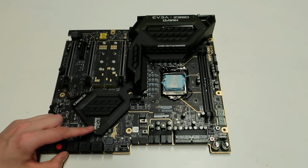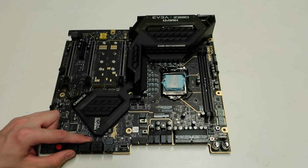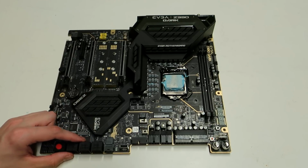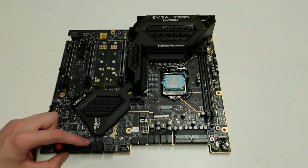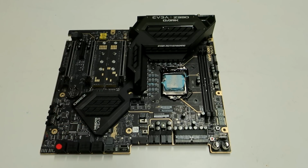For example, the ASRock Z170M OC formula. So with such a board you don't even have to worry about the AHCI driver. So Asmedia ports just have much better overall compatibility with older operating systems than the Intel SATA ports. So without further ado, let's get this guide video started.